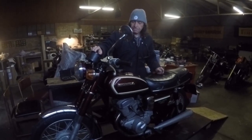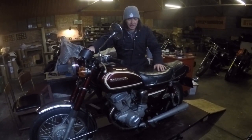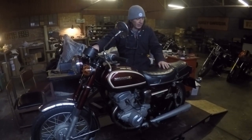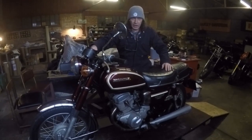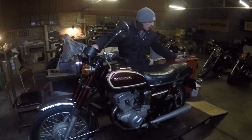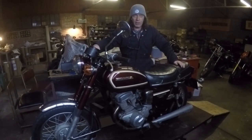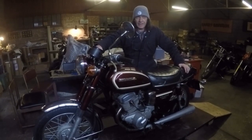I'll turn that off and just try and fix the brake light. Well, that was a bit of a damp squib. I was ready for the off, and then at the last moment doing my pre-flight check, the rear brake light wasn't working. Obviously, you can't go out without a working rear brake light. So I've just been tinkering - I took the seat off and sure enough, there was a connection that had come undone under the seat. I do need to pick through all the electrics on this, but we're just doing a shakedown run, we're not going to go far. I've just got the connector back together. We do have a rear brake light now - rear brake light. I think we're ready to go. This is truly an exciting moment for me, this rose-tinted spectacles trip of mine. Haven't been on one of these for 40 years. Let's see how it shapes up.